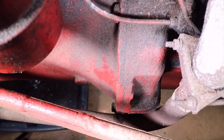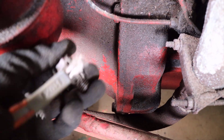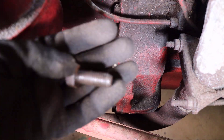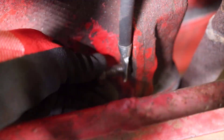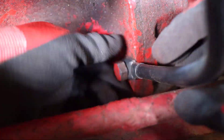While the battery was charging I chose to look at the fastener for the ground cable. I wanted to brush around it to get some of the loose dirt off of the threads. I also cleaned the mounting area a little bit with sandpaper before installing the new battery cable and fastener, which would then ground the electrical system.